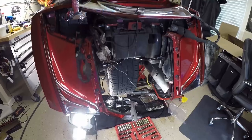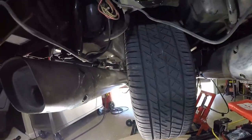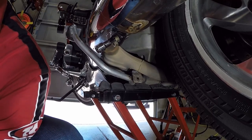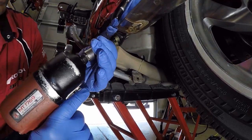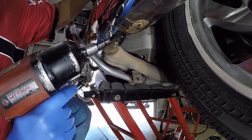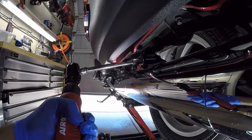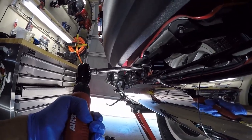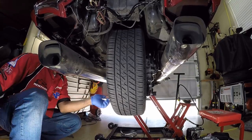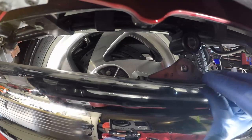I had to remove the rear fender and the rear turn signals to open up the rear of the Honda Goldwing and make the rear end more accessible. In order to gain access, I unbolted the muffler on the right and left side. This allowed me to lower the mufflers a few inches — I didn't have to remove them, but I needed to lower them. This was not in the instructions, but loosening the mufflers just enough to bring them out a few inches made it easier when it's time to install the main hitch frame, giving me the additional room I needed for working space.